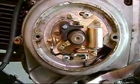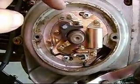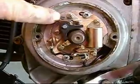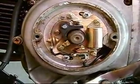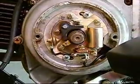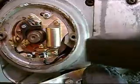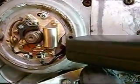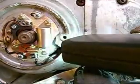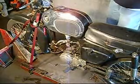Now what we've done is adjust this little cam right here. Some of these have cams, most of them don't. If you can see it in here, I'm going to move the camera over and try to get this flasher out of the way. You're probably just not going to be able to see it, but we got the timing mark lined up. Okay, we're back and we're going to get this started.